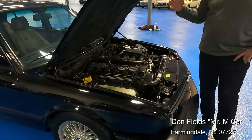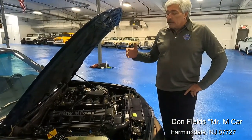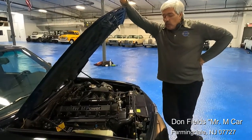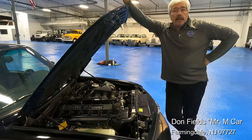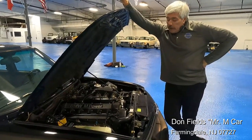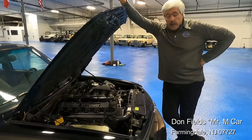One of the things we did is he wanted very good air conditioning for the car. These cars from the factory had a huge problem with the AC system — it just wasn't cold enough, especially on a black car. So we sourced an AC compressor — a 134a genuine BMW factory compressor from the later model '91 M5 — and fitted it to the car. It fits perfectly.